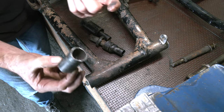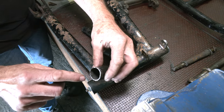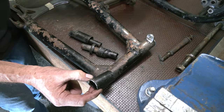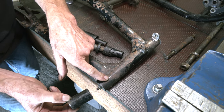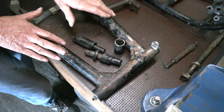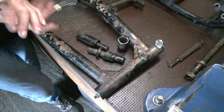Then you're left with the outer part of the torsion rubber assembly, or silent block rubber. Same again - get another drift which is just undersized of this. Push it through in here. Before it comes out, you want to weld up in here - build this up so that drift, when you press it in, it's going to come up against the welded area. And all you're doing then is drifting through and it's got something to bite onto. Put a bit of heat on with your blow lamp, get that nice and warm and just drift it out. It's not a nice job, but it's worth doing - if you're doing a paint job and it's going to be powder coated, they have got to go into the oven and the heat process might destroy those rubbers. So let's have them out and put new ones in once it's been painted.